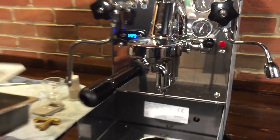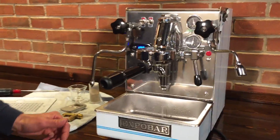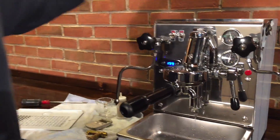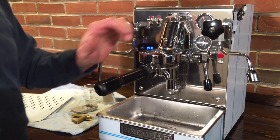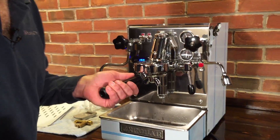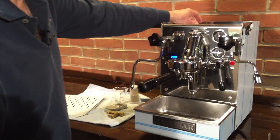Before you put the lever down, you always want to put the drip tray back in or you'll make a mess. Putting it at 10 with the backflush disc in gets you actually nine bar at the group — exactly nine bar when you have a flow rate of about two ounces in 25 seconds, which is roughly what you're going to have for espresso, depending on the blend of coffee and your grind settings.